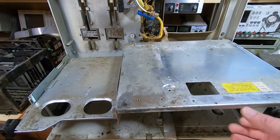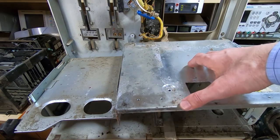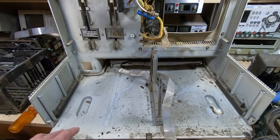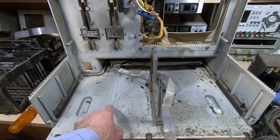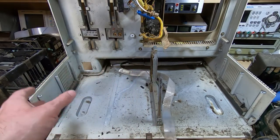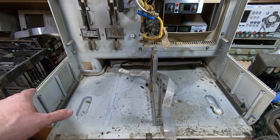I've finished the initial disassembly, and things haven't really improved. The center portion of the chassis is not looking too bad and will clean up fairly well. Even the lower chassis — though it looks really disgusting — will clean up quite nicely; there's nothing in there we can't manage. The thing that concerns me a bit is there is liquid damage in here — liquid has been running through this, so I suspect it was stored in a loft or a shed that was leaking. Haven't looked at the keyboard yet, but I'm suspecting there'll be a lot of corrosion on that if water has been running onto it.